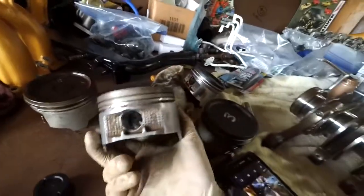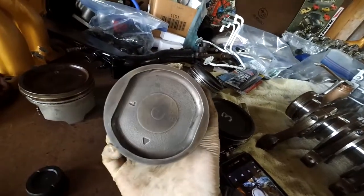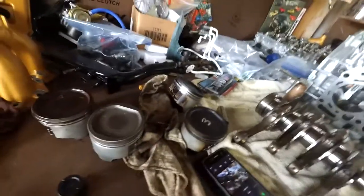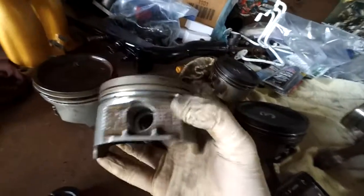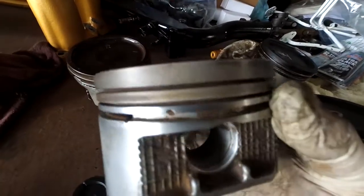I've just been working on cleaning up my pistons. This is number two — all clean. These are just the stock 22T pistons that came out of this motor, which had about 135,000 miles on it. This is actually the motor that came out of Forrest's '91 SS, so it's kind of cool that I'm rebuilding it and putting it in my wagon. The main thing I've got to do is get inside these ring lands and get all the caked-on old oil and stuff out of them.